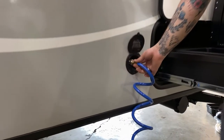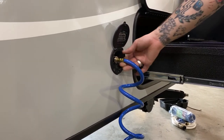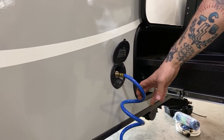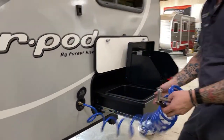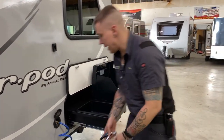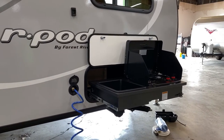There is a sprayer hose here with a quick-disconnect air hose style coupler. Slide the collar back to release the male end, and on the way in, slide the collar back, insert the male end fully, and once it clicks it will automatically pressurize the hose. When disconnecting, cut the flow of water to the unit and depressurize the hose first before disconnecting — otherwise you will get a burst of water because it is under pressure.